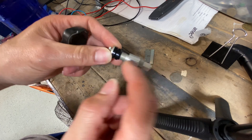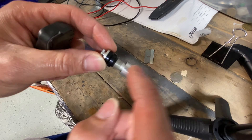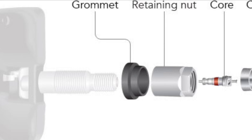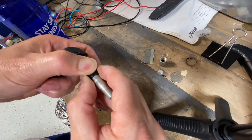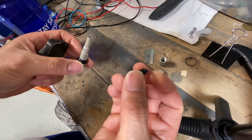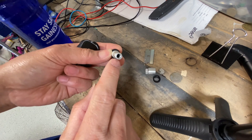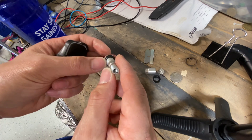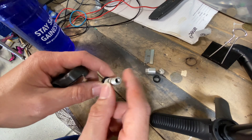The only things replaceable on this sensor are the rubber grommet, the washer, and the lock nut. Every time they change tires they're supposed to replace these - Discount Tire does it for free, and most other places charge two or three bucks for what they call the fit kit. One important thing with the valve stem inside: make sure they're not using dissimilar metals. Using brass with aluminum will cause oxidation and corrosion, so many tire shops now use stainless or aluminum valve stems.